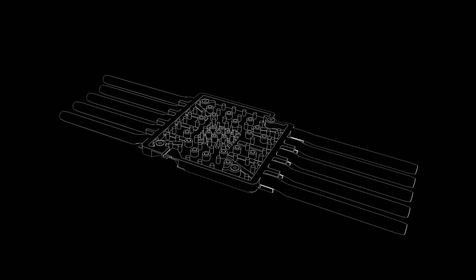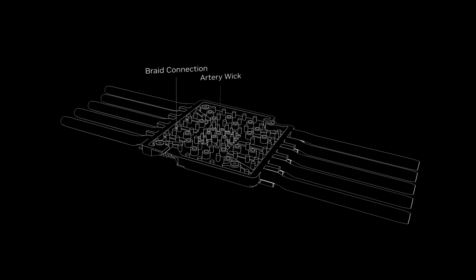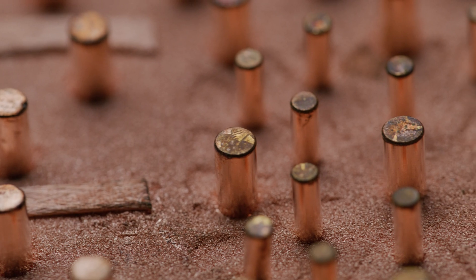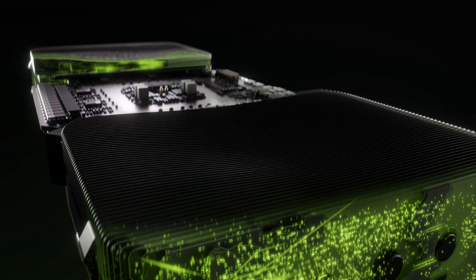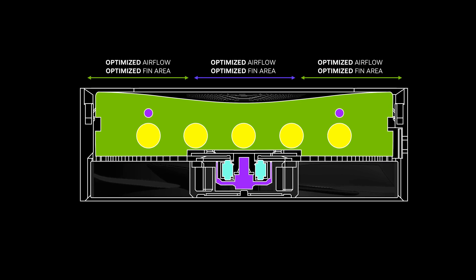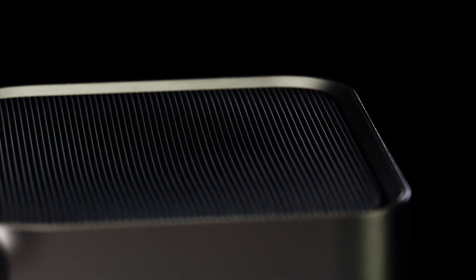In the 3DVC, we've come up with the first-ever artery wick. We have high heat flux regions of the GPU that need a lot of water, so we increase the thickness of wick above those areas to pull water into those high heat flux areas while minimizing the total thickness of wick in the evaporator area. Those heat pipes travel out into the fin stack of the cooling solution. A traditional fin stack is planar to the PCB, but in the RTX 50 series, we have a 3D fin stack — we scoop out the material below the hub of the fan.